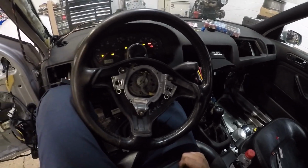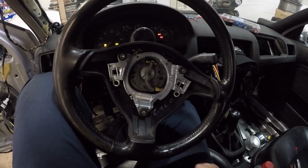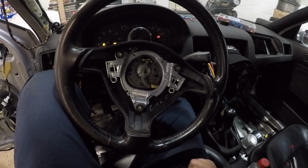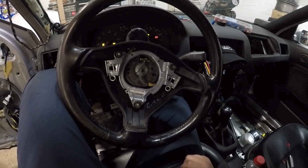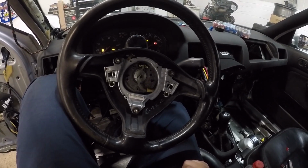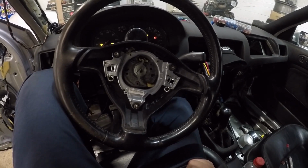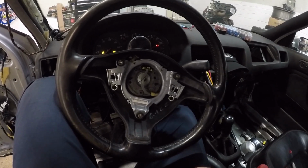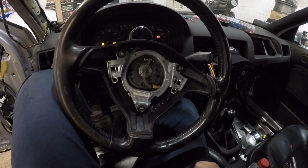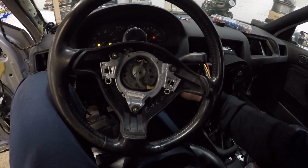We've tried a different control module, like a different comfort control module. We've tried finding any shorts, any missing wires, checked all the fuses, relays. So there's just no signal going to the switch. When you press the button, it doesn't send anything to the ECU because there's nothing on the wires. So we're just gonna splice into the brake pedal, and it should work. But yeah, I'll show you that it starts.